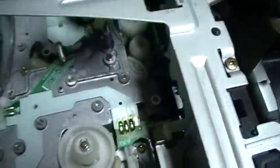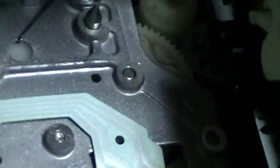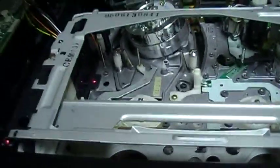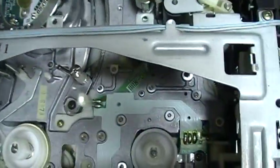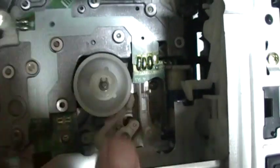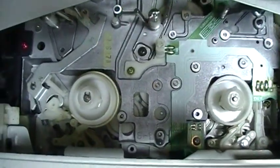This gear is made of metal, which is not common for VCRs. My Panasonic VCR with the K-Deck mechanism also has a cam gear located around there, and has that kind of metal gear for the ejecting mechanism. This is the G-mechanism — it uses only the capstan motor to drive all the functions. There is a solenoid that changes the position of the mechanism to put the loading mechanism in contact with the capstan motor mechanism.